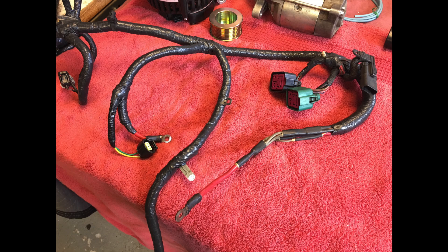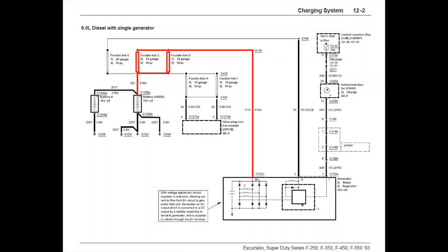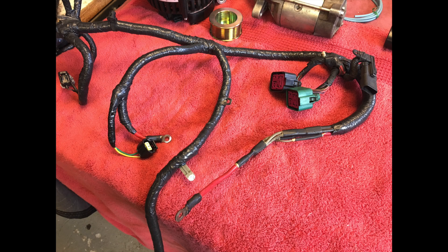Our factory cable has a long path due to its lay, and it has a number of fusible links: two 12-gauge for the alternator, one 20-gauge for the alternator sensing circuit, and two 12-gauge for the glow plugs. It's an essential cable because not only is it the main path to the batteries, it multitasks for all those pathways. Therefore, it's a complicated cable assembly if you try to replace all of it, and it's incorporated into the main engine harness.